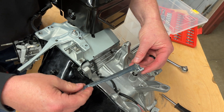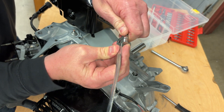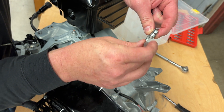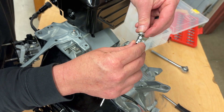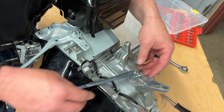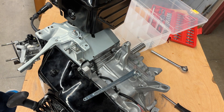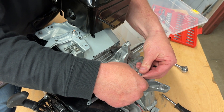So we're going to start the governor arm here. Governor arm slips on nice. In case you took this all the way off, hopefully you put it back on. But this bolt — that governor arm bolt — kind of has a D head on it. That flat spot goes against this flat spot right here. Then that nut just starts out. I can put that arm right on there, and we're going to set this in a moment.